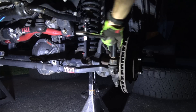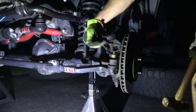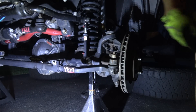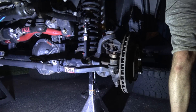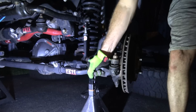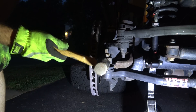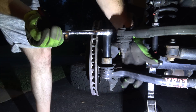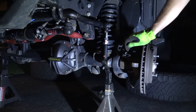What I'm doing is loosening up this nut to give it a little bit of space. I want to have this tie rod pulled down — it's a tapered bolt in a tapered hole, and whenever you tighten it up, it press-fits in there. So the way to get it out is with a hammer. That's how you release a tie rod from the knuckle. This side already fell at the same time, so now I can pull this nut off the rest of the way. Knuckles are free, no tie rod.